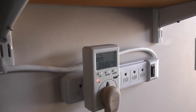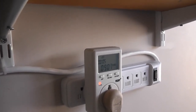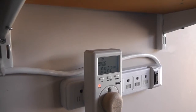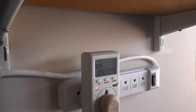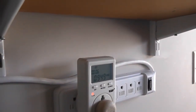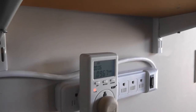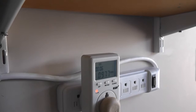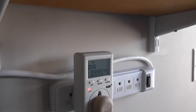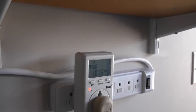Basically, I've taken it out for a drive — say 10 miles — so I hook this up and let the car charge. When it's done it'll tell me the number of kilowatts it took to charge. I divide the miles into the kilowatts and that tells me exactly how many kilowatt-hours per mile it costs to run the car. Since this also calculates the number of cents of electricity used, I can divide the miles into the cents on the meter to get the direct pennies-per-mile cost.